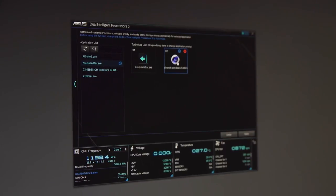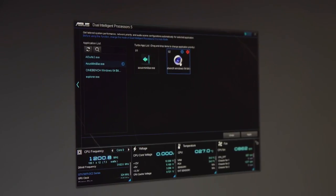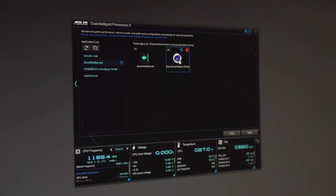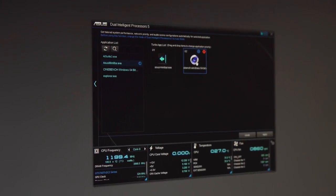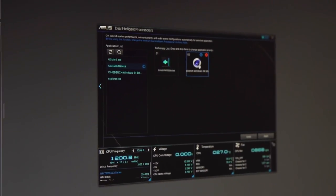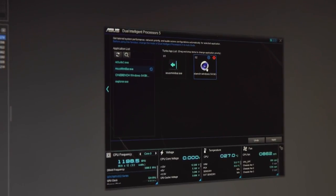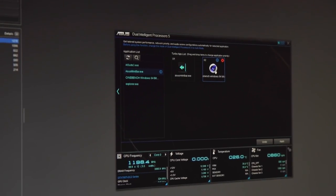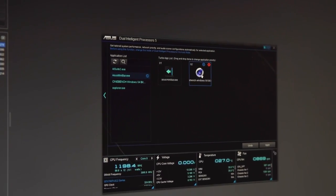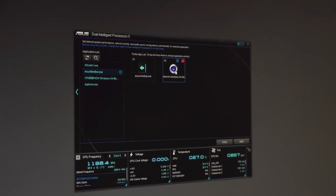But that's a really advanced way of customizing. Most people don't think about that because they think of their system running essentially the same level of functionality all the time for every program. But we don't need our programs to run that way, especially for some programs that take advantage of one kind of level of functionality compared to another. Like Lightroom, like I told you, it's really only well suited for one or two threads. So you'd much rather have it run at very high frequency on two threads, but then when you go into Premiere, Premiere can use all your threads. So you maybe run it at a lower frequency, but on all cores. So like 4 gigahertz on all cores, versus when you're in Lightroom, it runs at 4.6 gigahertz, but only on two cores.